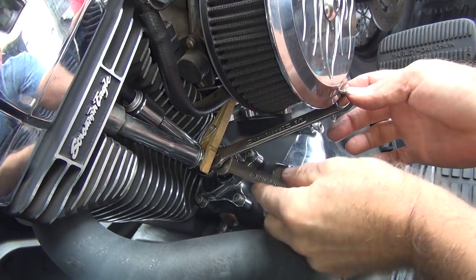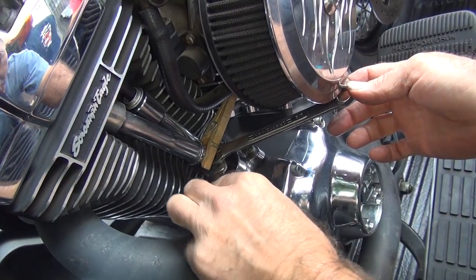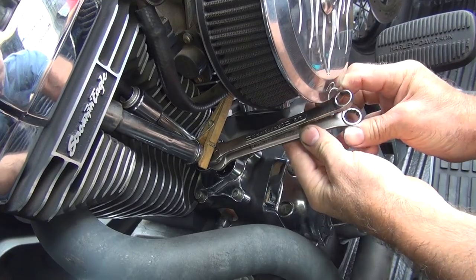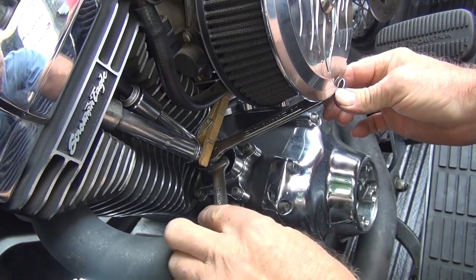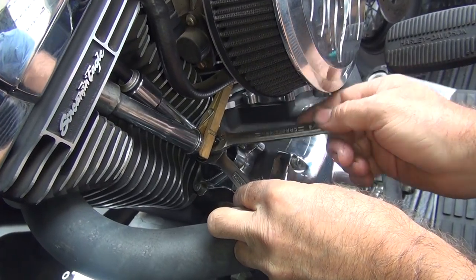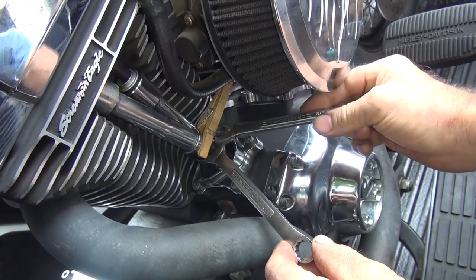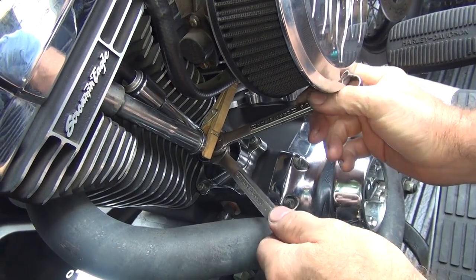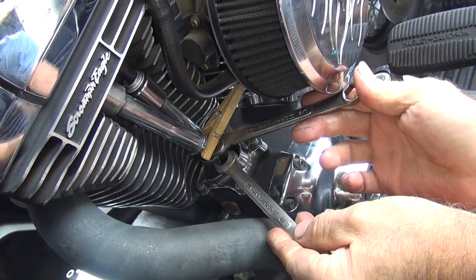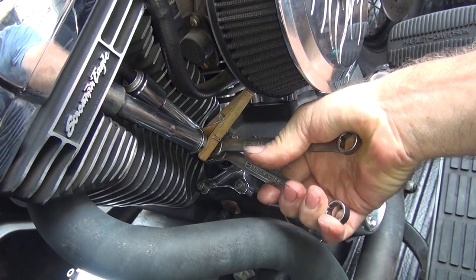It comes back a little bit — you say you do an extra one to bring it back so when you tighten it you don't lose it. Yeah, but if you have an extra one with four flats it's a lot more than if you got six flats. Right now I can't get to the damn thing because you've got an exhaust pipe with an air cleaner in the way. See, it's too big of a jump — there's too much crap in the way. I can't get my wrenches in here. There we go, found the right spot. Now we can squeeze it.